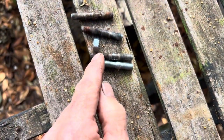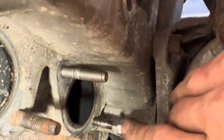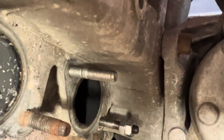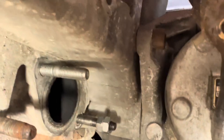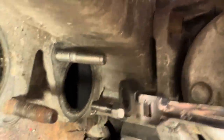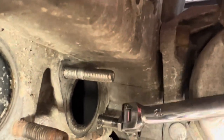Whereas the ones that are in there you have this bit sticking out the end, which is obviously the rustiest. It's quite tricky winding these studs back in. The way to do it is just to put two nuts on there so they lock together, and then in this particular case I'm using a ratchet spanner with a kind of flexible end, and that works pretty well to wind this in.